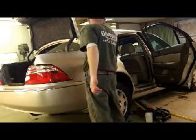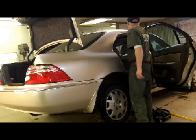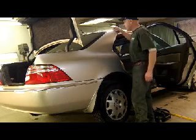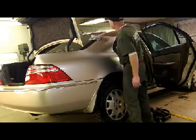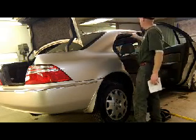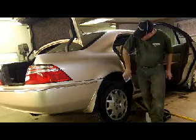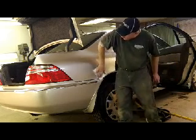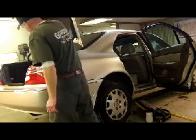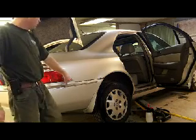Before I ever start tearing it apart. That way, at least in my mind, I know that I went over it to get all the wax off of it. And I decided not to do a solvent blend up there. I took off all the trim along the top and I'll soft edge that. I don't know why I didn't do it last time. I was probably afraid of breaking the trim clips. But we'll pull the tail light out, I'll soft edge all that in there.